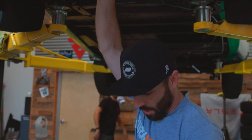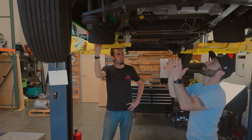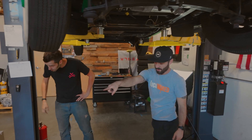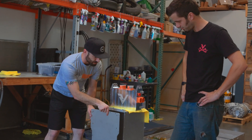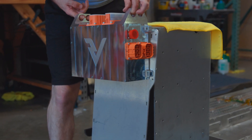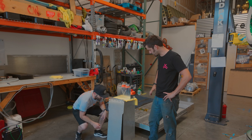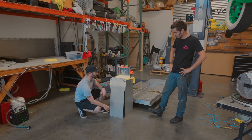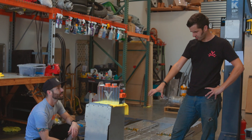So that's where the skateboard is going. Now we have the tombstone — about 15 inches from this cross member to the firewall — and we're going to have a four-module stack going up from the bottom, fastened to the firewall and against the cross members. We call it the tombstone because it kind of looks like a tombstone standing upright. It's going to serve as a mounting plate for the high voltage junction box, so a lot of the controls and switching will be accessible for troubleshooting or installation. I think it's going to look great, with cables coming right out neatly on either side.